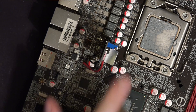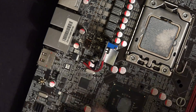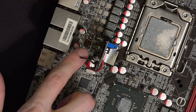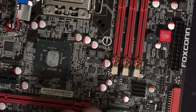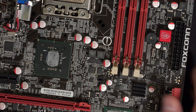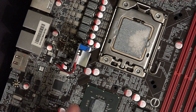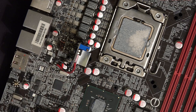The way I actually got it up and running — obviously we have the Ample — but there was a bit of a process to this. The first thing I did when I got the board was take it apart, noticed there's a scorch mark in the VTT VRM. The first problem was that this was actually shorting the 12-volt power from the 24-pin connector to ground — so that's not great. Because that basically means if you tried to turn it on, the short wasn't super low resistance, it was a couple ohms, so it would have probably managed to turn on and then gotten really hot as the short circuit would just pull power into it and possibly cause more PCB damage.